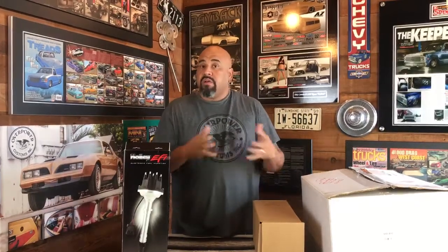The way it works is a lot of guys are going EFI on their carbureted systems. I particularly am running a small block on Bernadette. So when you get your EFI system, you also need to upgrade that distributor. It's not going to work with the old distributor from your carbureted system, so Holley makes it easy.